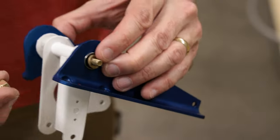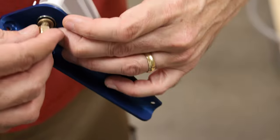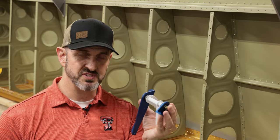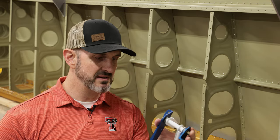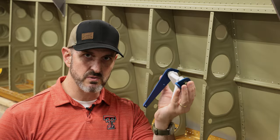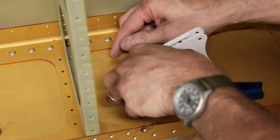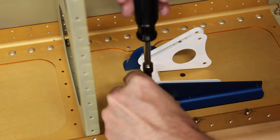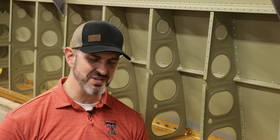Once you have this assembled, you screw the nut on and torque it down to spec - which for these number four bolts is between 50 to 70 inch-pounds - and then you just attach this to your rear spar and you're ready to go. Really that's it. This kit allows you to have really nice ball bearings instead of bushings.